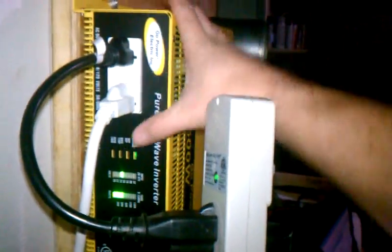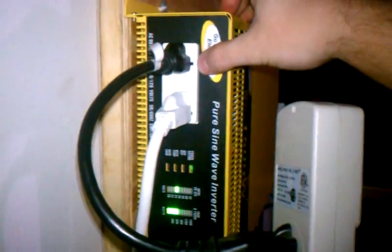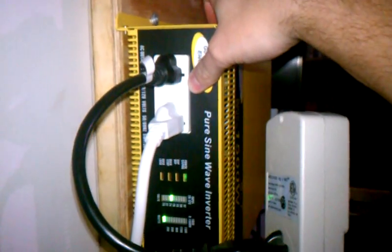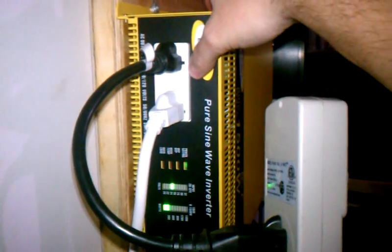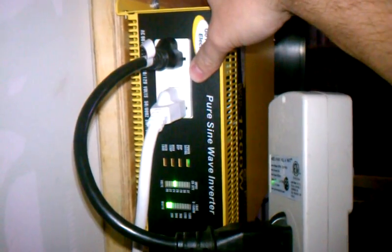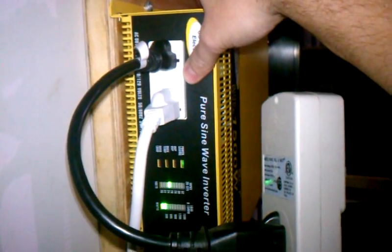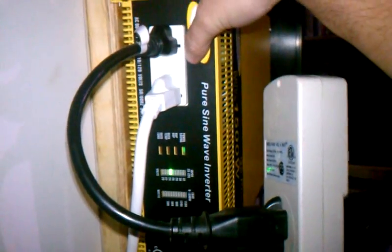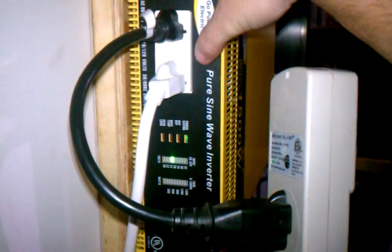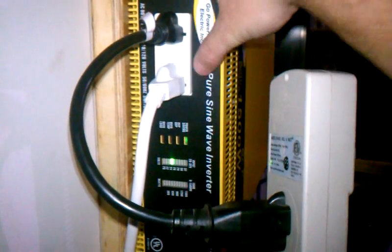The power save mode and all that stuff is really cool. The only thing to mention is that when you plug something in and you have power save mode turned on — you can see it's enabled with this little light here — it takes five seconds to recognize that something's trying to get power. So you push the button on your TV or laptop and five seconds later it's flipping on, which is really odd. You can turn that off, but then it's like a 15 to 16 watt draw all the time. If you keep it on and deal with the five-second delay, it's a one watt or less draw — about 0.047 amps constant. Also, you have to draw over 40 watts to wake it up, so a phone charger just won't register. You can plug a UPS under this, leave the UPS on — it'll draw 40 watts — and plug whatever you want into that.